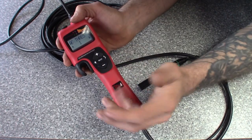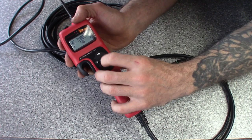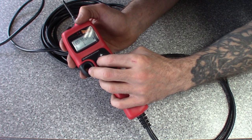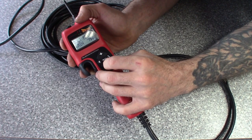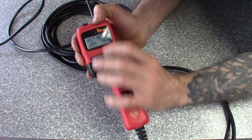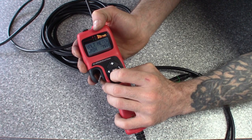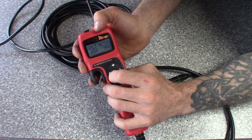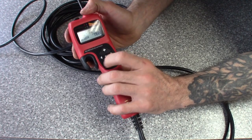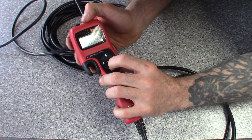In the menu you have power switch modes: on, momentary, latch (hit it and it stays on), and pulse (about 2 seconds on, 2 seconds off). AC threshold can be set all the way down to 0.1V — very precise. It also does parasitic draw testing: run it in series with the battery, set to 65 amps, make sure all modules are asleep, and leave it overnight. It saves the result — showing you the current draw — so you can catch intermittent parasitic drains. It also has injector mode and a count mode, though some features I haven't fully gotten into.